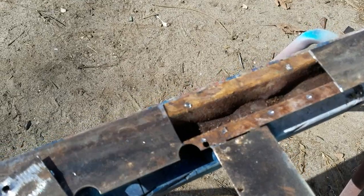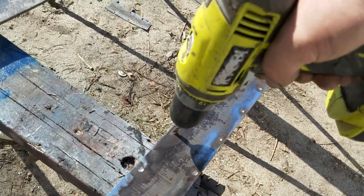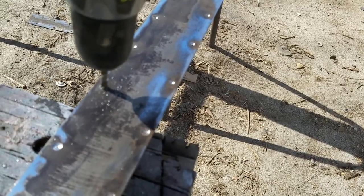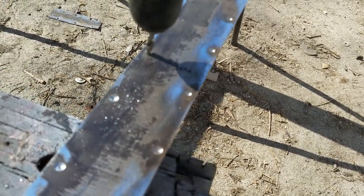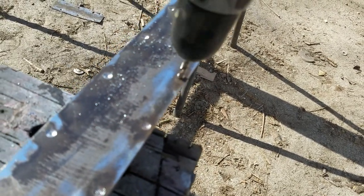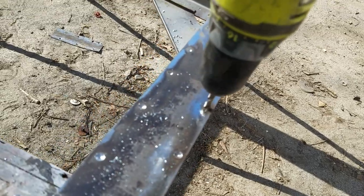You can see these horrendous dents at the bottom where people have closed the door on bits that are sticking out. So I've got to drill the spot welds, remove these sections of the inside of the frame, then I can get in with some tools to the outside of the frame and get on with removing those dents.